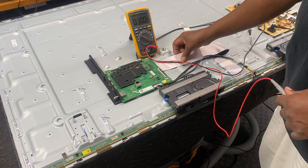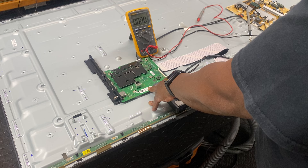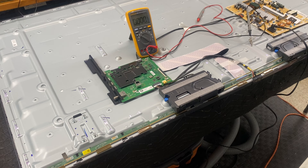The voltages that drive the panel aren't there, and that's because it doesn't see the panel. So I can assume that the main board is bad and swap it out and put another one in and see if that fixes the problem. The main boards always have the tag labeled 700DF instead of 7000, even though it's a 7000. But in my experience, I've replaced a lot of main boards on these TVs, and it always turns out to be a bad panel and not the main board.